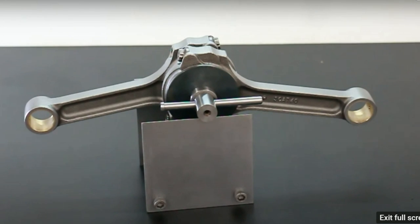What you have to do here is mount the rods on the mounting shaft and clamp them so that the bar and the rods are at a uniform level. Right, so when you put the rods onto the fixture, the bar is virtually horizontal. Now you'll see that I've got the rods drooping down. That is to make the balancing a little easier. It is just too sensitive to do them with the rods horizontal.